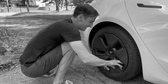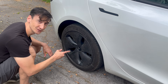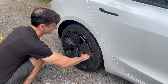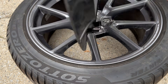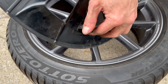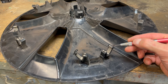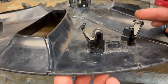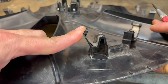You probably remember me struggling in the first part of this video — watch how much easier the old style of aero cover comes off. You can see on this one I've actually cracked the outside of it because it was gripping so hard onto the wheel that it split the plastic right there. And it's because of the difference of this little metal tab — you can see this one is on top, and this one has actually gotten sandwiched behind there such that it's next to impossible for it to flex over.